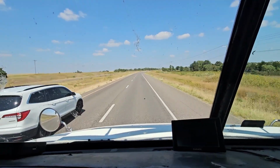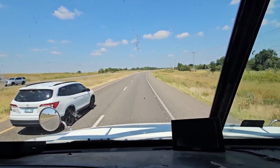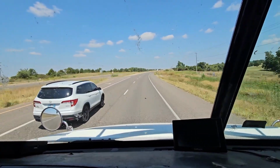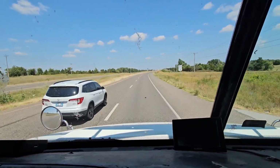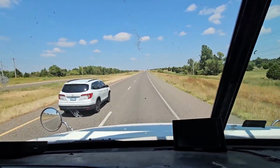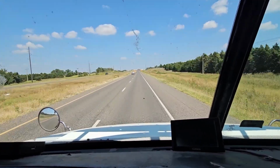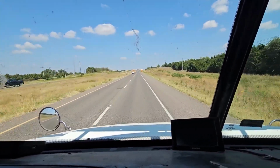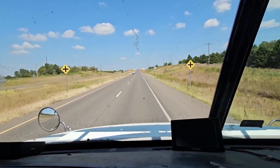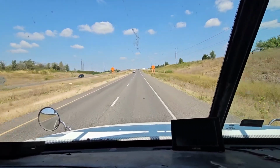All right, one more thing. Let's hit the Jake brake, boys. And when you hit the Jake brake on this truck, it automatically turns on the fan clutch because the fan clutch helps slow the truck a little bit. So that's been one of the main times that the screeching has happened when that Jake brake kicks on. So let's hit the Jake brake at a high RPM and see what it does. Seems like the higher the RPM, the higher the chance of a screech.